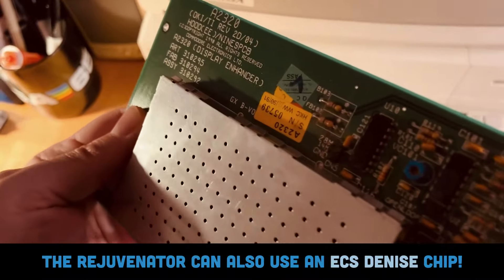But most importantly — I should also mention it has a video port, so a small handful of video cards could be used at the time. But the really big upgrade that this gave Amiga 1000 fans that they always wanted, but were never really given any kind of attempt to upgrade by Commodore in particular, or even third parties because it was so difficult — the ability to pull out your little Agnes that it came with and replace it with a fat Agnes or even a fatter Agnes that would give you up to one megabyte of chip or even two megabytes of chip. Back in 1990, when these were being sold, it was just a shocking concept to even wrap your head around that your Amiga 1000 could play with the big girls. Hell yeah, she could.